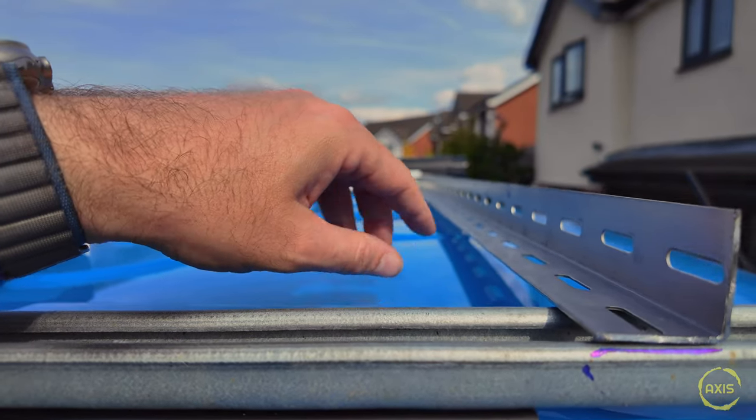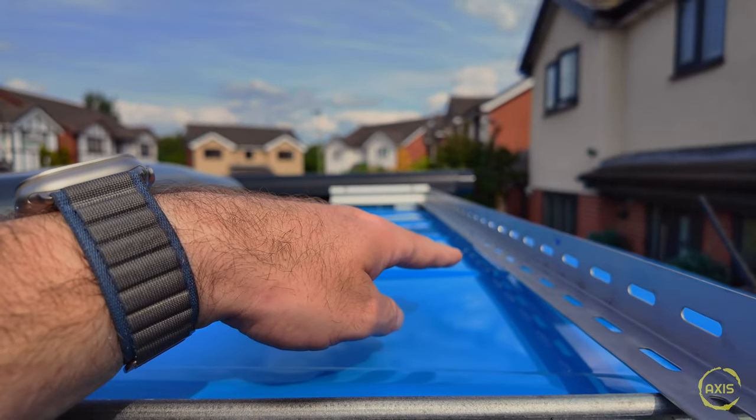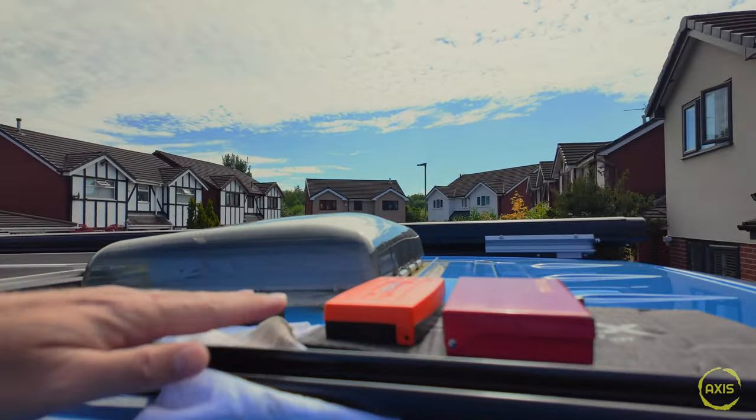I'm hoping for a good 10mm clearance. I don't want the light too high though - I could have just basically mounted it to the van bodywork with rivet nuts, which would have been easier. But if I change my mind or want a different light, I don't want it to be a permanent fixture on the van. I can just whip this bar off, take it off the bar, and put something else on if needed. It also gives me the option to add other bits. So let's get these drilled, get that light mounted, make sure everything fits, then my painting.